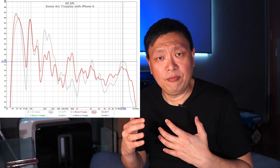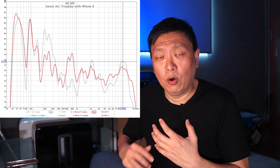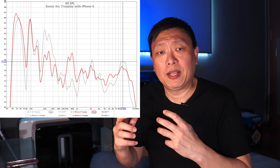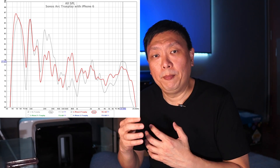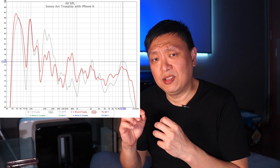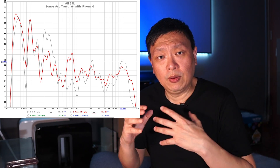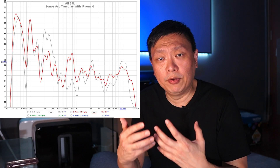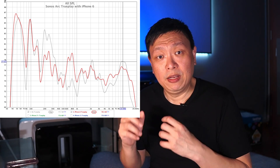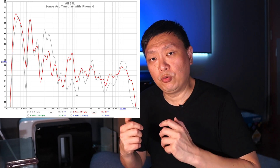The rest of the mid-range is rather unaffected — TruePlay simply tries to flatten out the curve a little. At the treble end, TruePlay pulls up the response from 3kHz all the way to 7kHz, which is the audible range of the treble. I suspect this is done to enhance the directivity of sounds from a single soundbar to simulate surround effects. From 8kHz onwards, TruePlay pulls the peak down and smoothens the curve slightly, extending the treble a little higher. In summary, the iPhone 6 TruePlay tune enhances the bass a little, pulls down the human voice range, peaks the mid-range, and tames the treble end just a tad.